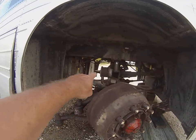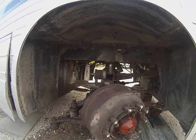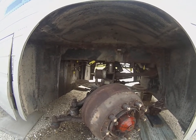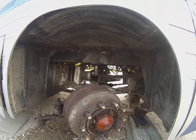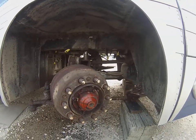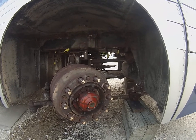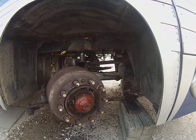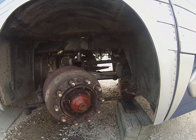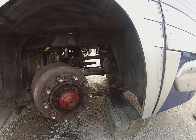You know, these guys here going across, that goes on 2 pegs. There's a solid bar that's in there. It's got to be right on, or you're going to be jacking or winching or something. So it's real important to start off with, to make sure that your bus is level side to side, front to back. All your chocking is done on the back wheels, and then go ahead and lift up your front wheels. I did use penetrating oil for a couple days beforehand.